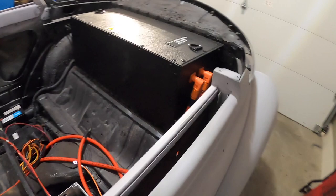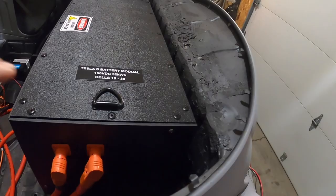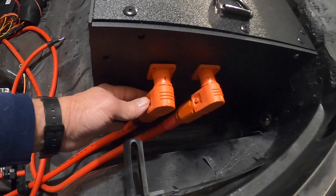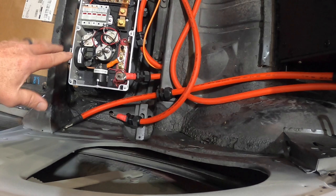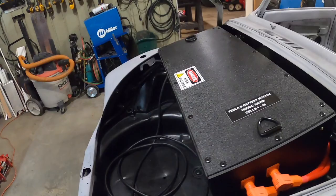More progress: I've got all the cables mocked up and the battery boxes sitting in place. The rear ones are still empty — I'm waiting for my BMS to come in so I can get that hooked up, then slide the Tesla S batteries into the box. I do have the 90-degree Anderson quick connects already done — all you do to disconnect is push this button on the side and pop it off. All my cables are mocked up, crimping done, shrink tubing on, and everything's ready to go. The front battery box fits perfectly with the right-angle Anderson quick connects for the 150 volts DC.